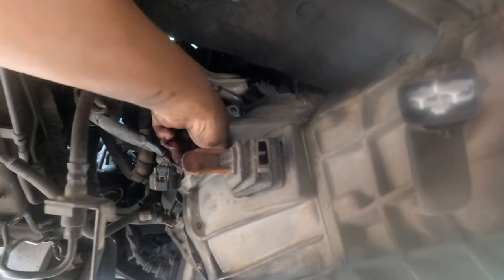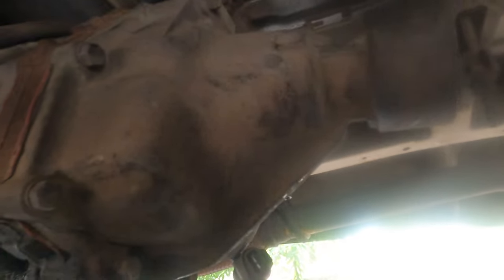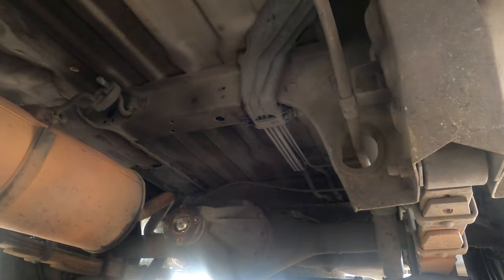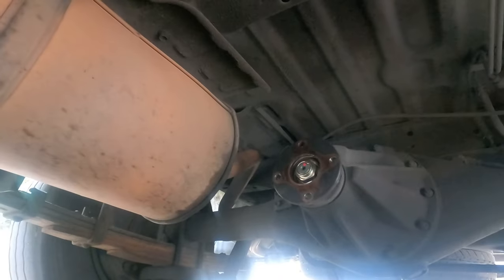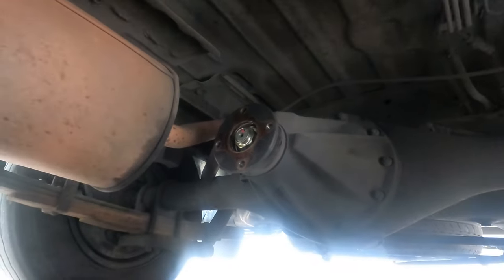I meant to buy it for the bike, not for the gearbox. It's worked well, and you see the gearbox has no oil inside as well. So the gearbox oil goes here. Open up this one later and put oil in until you can see the oil start to come out from the hole. That means it's full. Make sure you got some Loctite and put the power shaft back on before you put the gearbox oil in. Okay, always Loctite, brother. Loctite, Loctite.